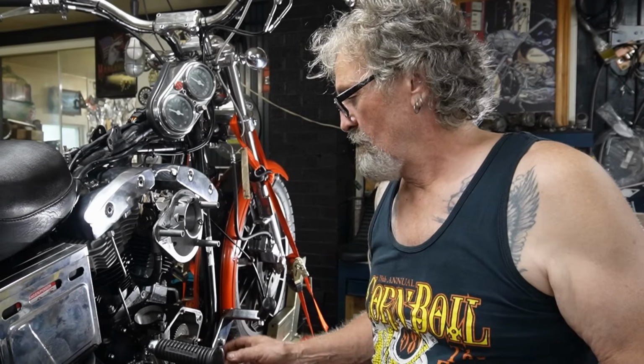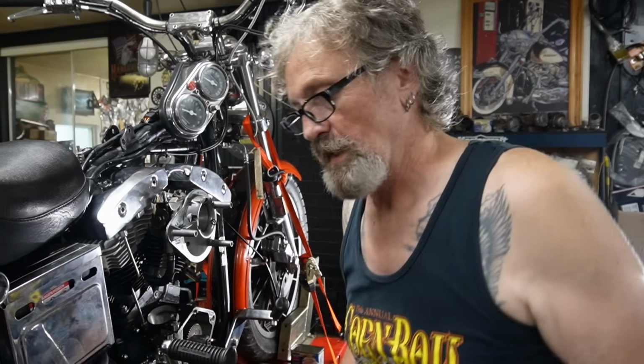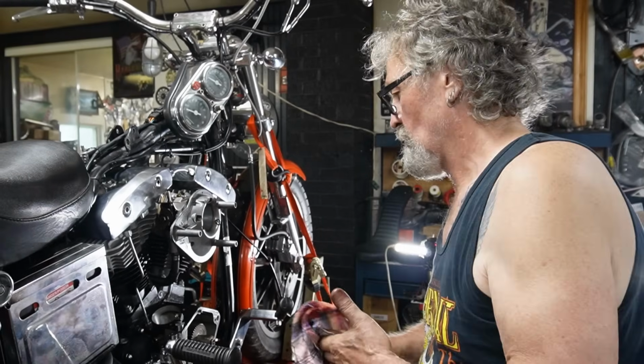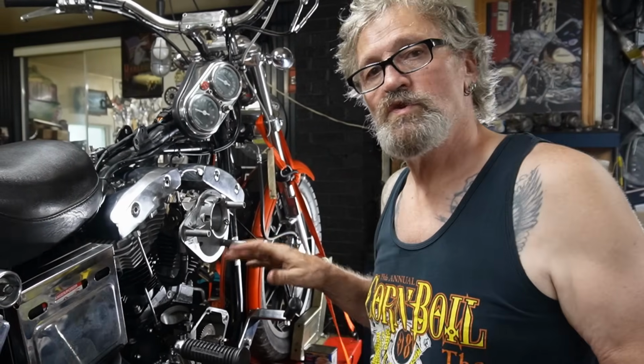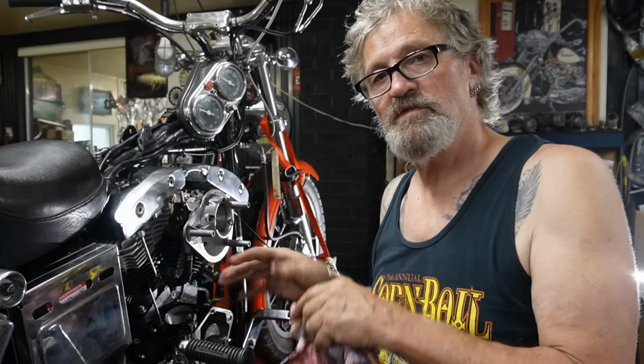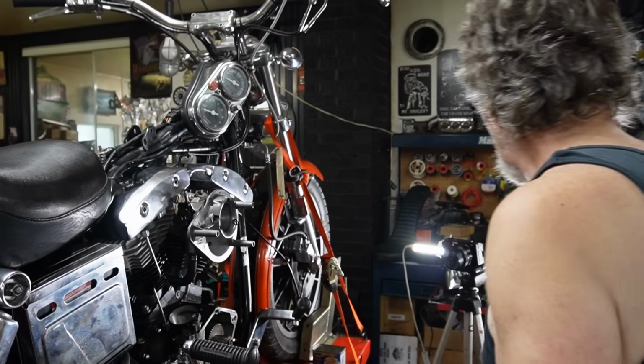So we know that all our oil pump gear is free. We've got our timing marks now. We've set our cam spacing and we've set our breather gear spacing. So all of those things are in place. So I'm going to go along and get my lifters now, and I'm going to put them in first so I can see what I'm doing. It makes it a little easier to get your fingers in there and have them come down where you want.